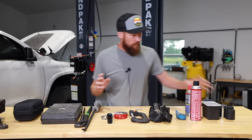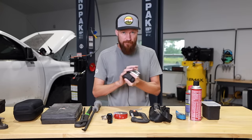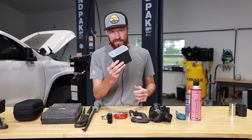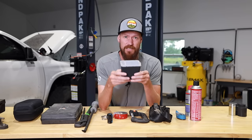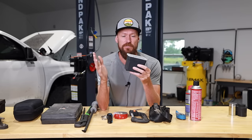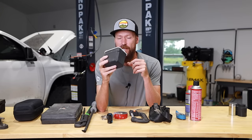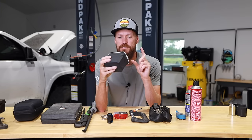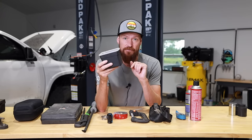Let's talk extras. We already covered sockets specific to your axle nuts and other custom items — make sure you have those. I also carry a hard-to-open case full of spare nuts and bolts covering all the different random accessories on my vehicle. If you have a rooftop tent, awning, roof racks, or solar panels, carry extra bolts for each. In there I also have extra valve stems for tires, Loctite, and a little tube of JB Weld. It's handy stuff to have.